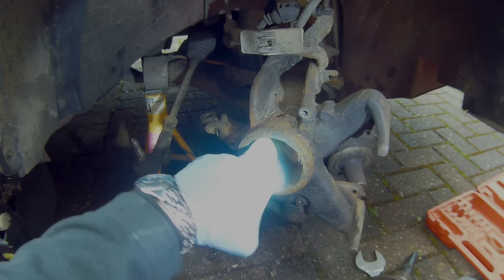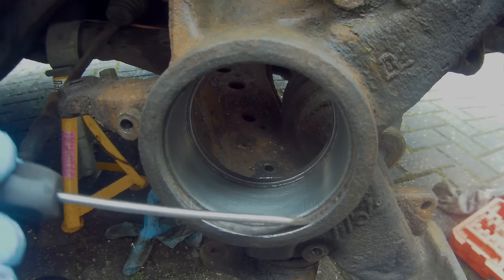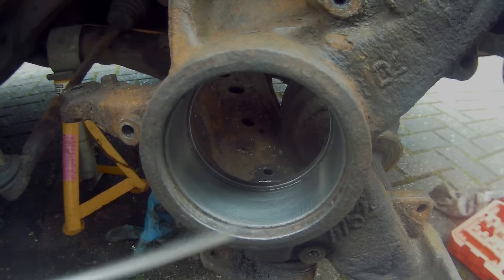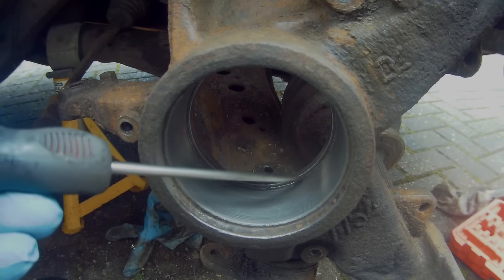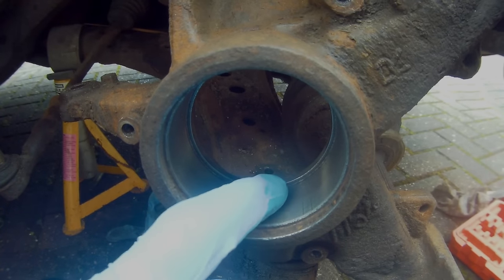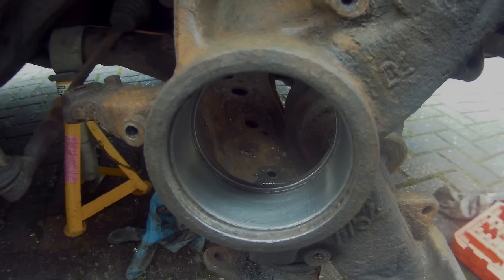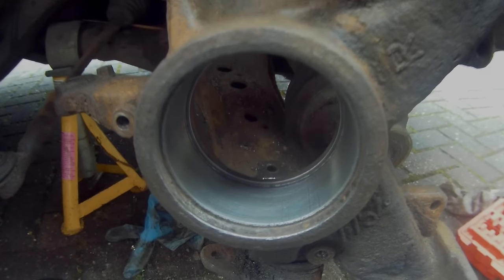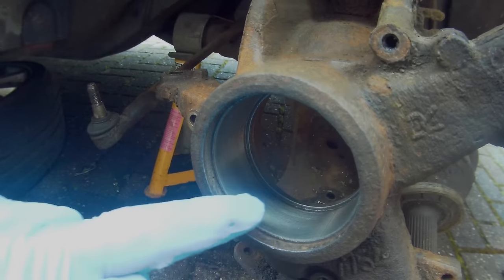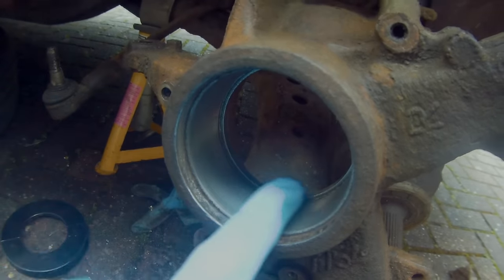So it has to be a really good fit up against that shoulder. This is the hub cleaned up — I've cleaned out all these rebates. This rebate here is all cleaned up, and where the bearing surface meets the shoulder at the back there's a little rebate that just goes down a little bit. I had to make sure I cleaned all that out so that when the bearing goes in it doesn't trap any particles and stops the bearing going right up to the shoulder, leaving a little bit of grease in the back to seal it. This rebate here is to fit this ring. The recommended grease to put in here is moly coat grease, which is a high pressure specific grease for this — just smear the inside of that surface.